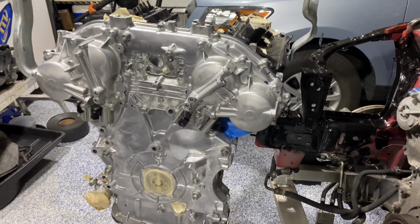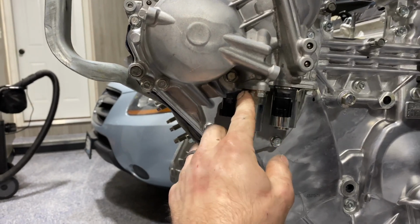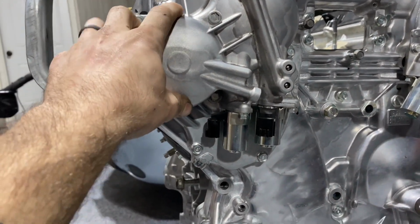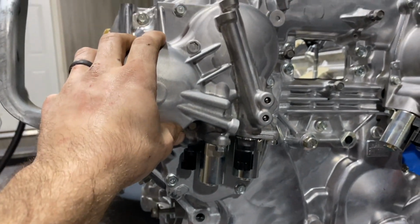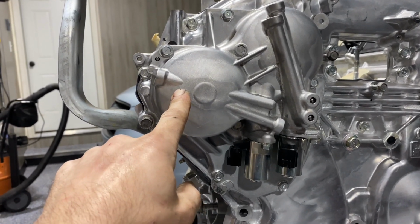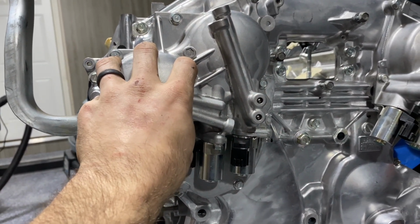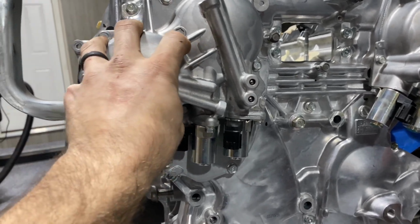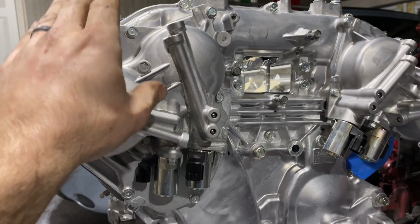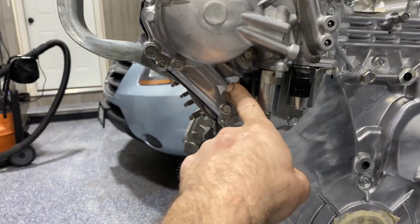of the engine. So the reason you cannot use the factory ECU is this guy right here, okay? And that is because this exhaust phaser is different. And when I say phaser, if you guys don't know what I'm talking about, probably would do some homework. But essentially, the camshaft is not fixed to a pulley or a gear, like in this motor, that's ran off the timing chain. And that's the same with the intake. They have phasers that can actually advance, retard the timing, etc., so that you have control over some of the timing control of the motor, which is how you produce horsepower.